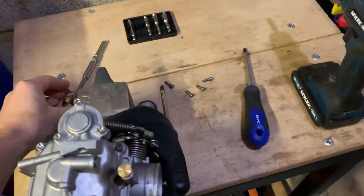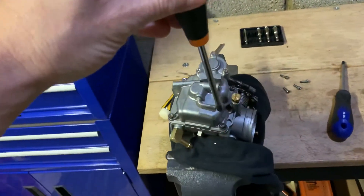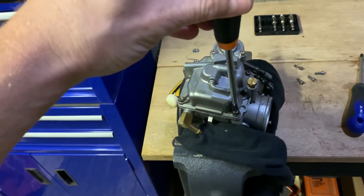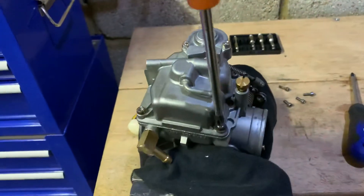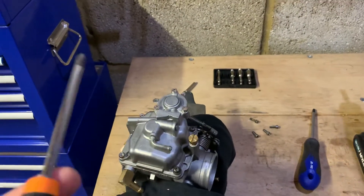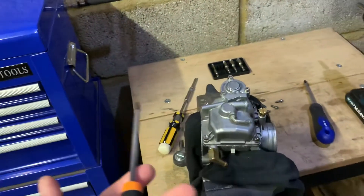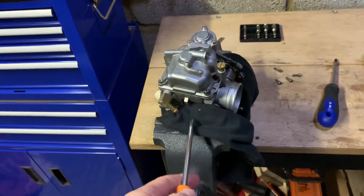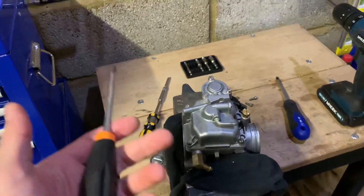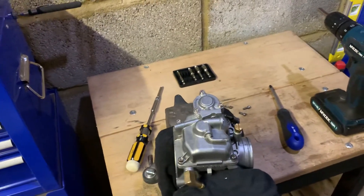You can't use a normal Phillips screwdriver because it's just not going to be a good fit into the head slots and it's going to strip it. Frankly, I didn't know this before — I used to use Phillips on my Japanese motorcycles, and a lot of people would have done this as well. So we ended up with all these used bikes with stripped bolts on the carburetors.